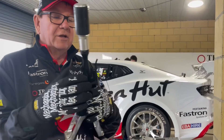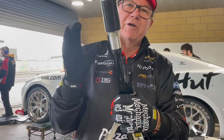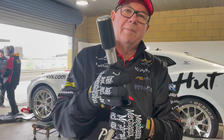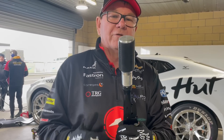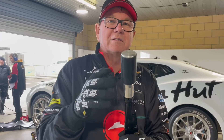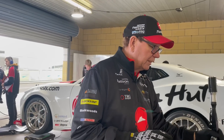The other thing to notice about the gear stick is this little lever here — that's how they grab reverse. If you go all the way forward to neutral then pull that back, it's got a cable that runs through the gearbox and then you can get reverse. The reason you can't just get it with the stick is because you don't want to be grabbing reverse when you're going down through the gears — so that's a lockout to make sure you don't do that.